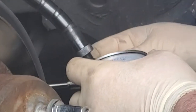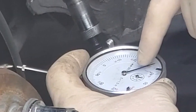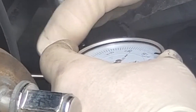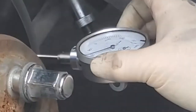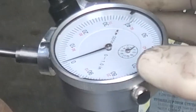I like to put the needle between three and four so there's enough pressure on it — somewhere in that ballpark. Tighten up the collar even tighter, then use the lever here to lock it down. Then we're going to turn our indicator to read zero.